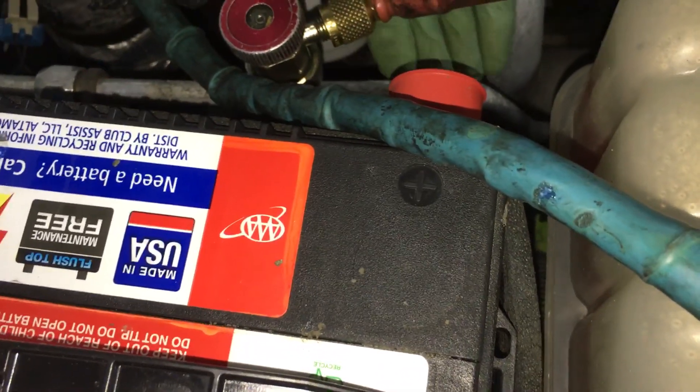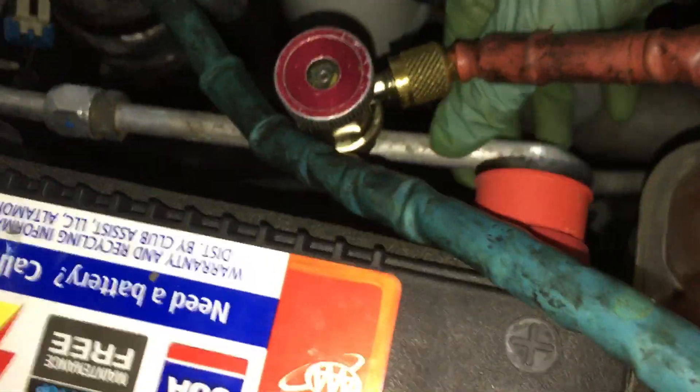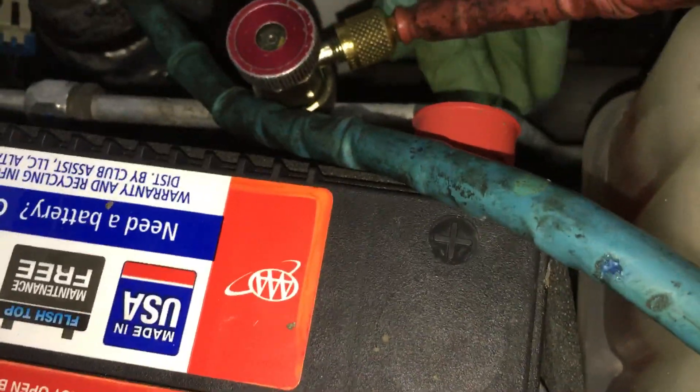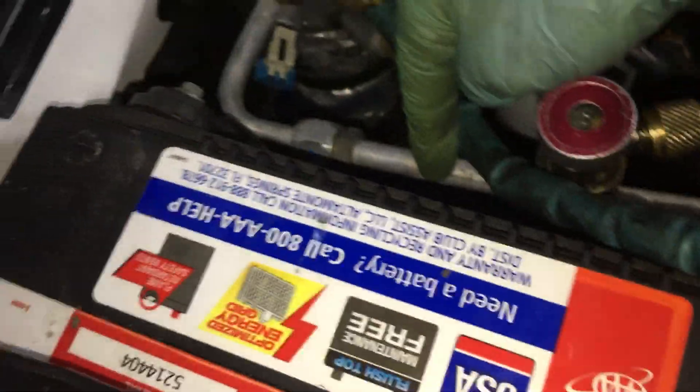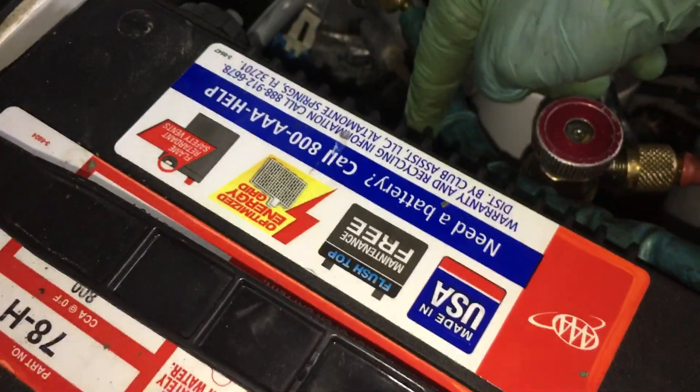About 4% oil is mixed in with your liquid refrigerant. And this is bigger than a 3/8 tube — this is almost a half inch tube filled with liquid refrigerant. But you have an orifice here, and I'm recovering from the low side, which is right from the orifice.